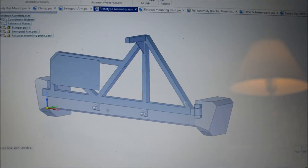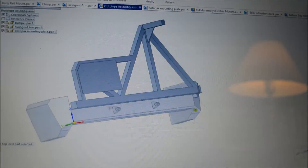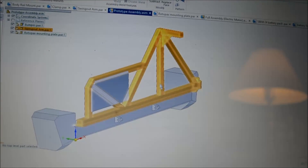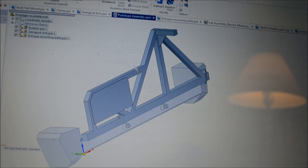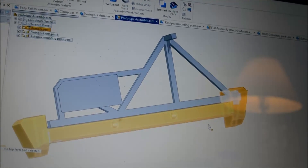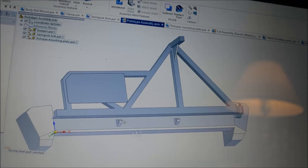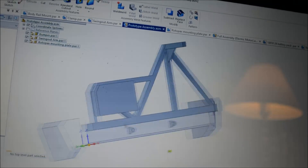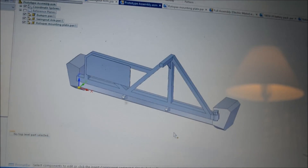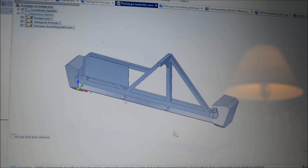So I've been designing a swing-out bumper. I'm a design engineer through education and a couple jobs now in design engineering, so I know my way around CAD decently. Here's a simple rendition of what I'm thinking — I'm going to add a few more angled pieces to make it look more unique. The swing-out is built out of 1.5 inch square tubing with a 2 inch square tube base. I'm going to run a pretty thick plate here so I can mount extra gas and Rotopax containers. I've got a couple D-shackle mounts and some cutouts for lights. I showed this to the builder and he said he thought it would be more complicated — so basically that's the green light to really go crazy on this thing.